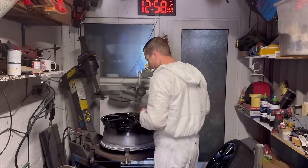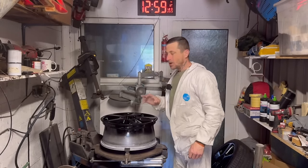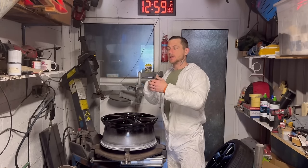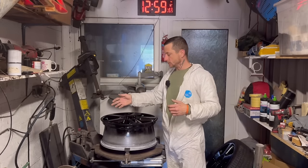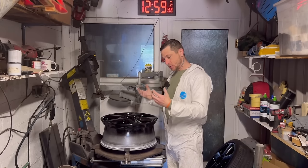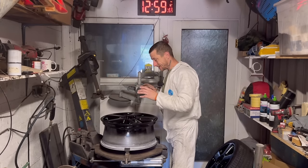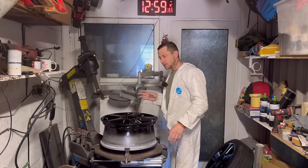A couple of days has passed. Paint has gone rock solid and they look good. I did give them a little polish with the polisher. When you paint wheels wet on wet — lay your primer down, wait for it to flash off, and go straight over with the paint — as the primer underneath dries, it pulls the shine out of the paint on top. So I just slightly ran the polisher over them. They've got my name on, so they need to be right.